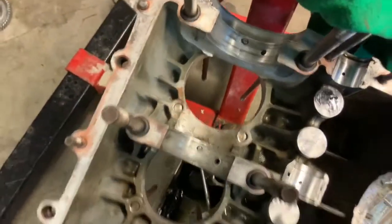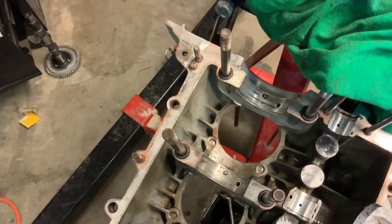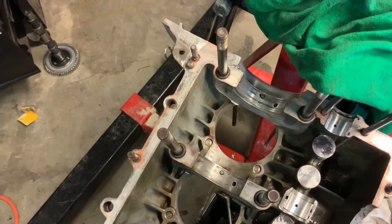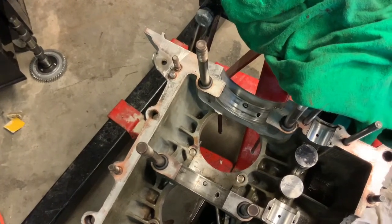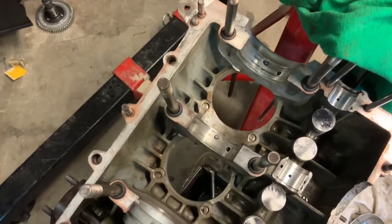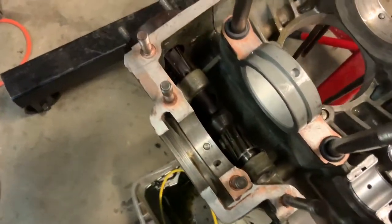And so what I had to do is very, very gently massage that burr out of there. I used a really fine file right on the very top of it. And then with my Dremel, I had like a 1,000 grit sander, and just sanded the top until I couldn't feel any more of a lip there at all. I'm hoping that's going to be adequate. This is where the cam is supposed to sit, and those are my lifters sitting right below it. So that's all fitting together relatively well.